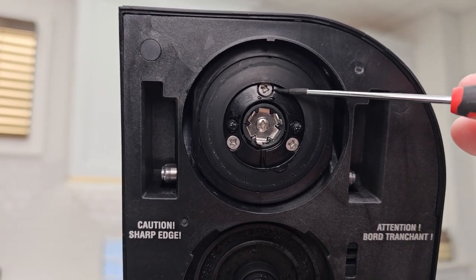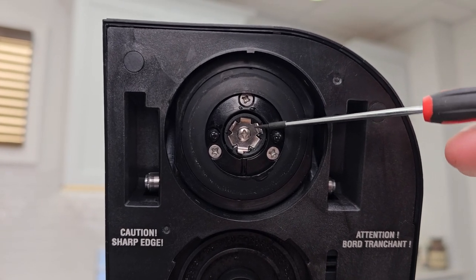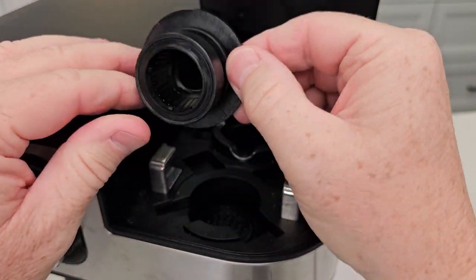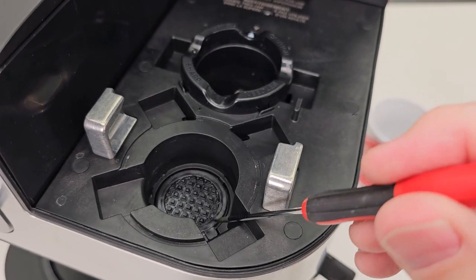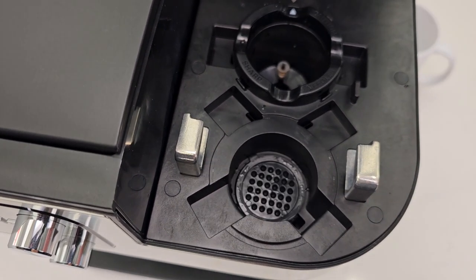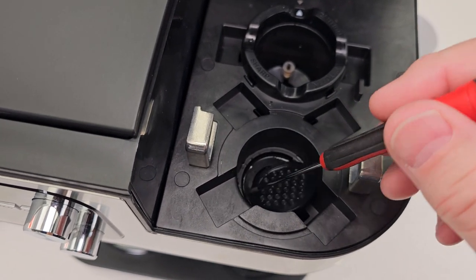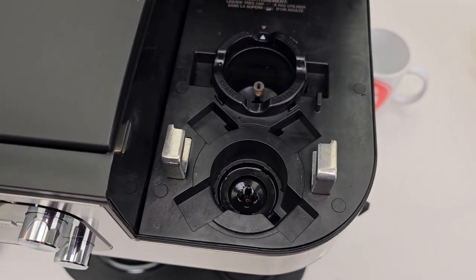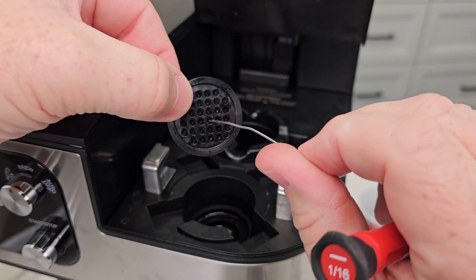Now the Nespresso side — I've not had to take these screws out. I have had to just take a brush up here and get this all nice and clean. This bottom one — you can take this piece out and get it all nice and clean, but where it pierces is down here. You can take this out by prying it up where that little notch is. Get a little screwdriver and pry up — that little piece will come out. Take it to the sink and get it nice and clean. I've had some foil get into those grooves. There are holes there but it takes something smaller than a paper clip to clean those out.